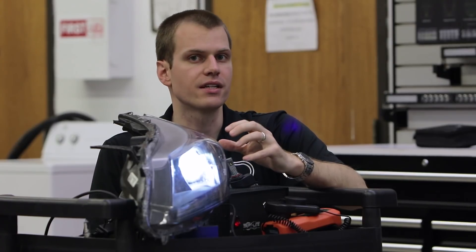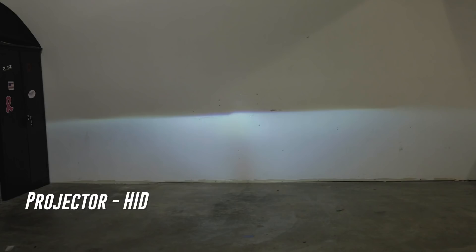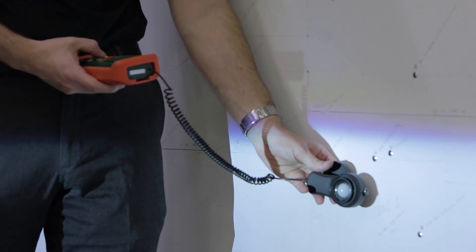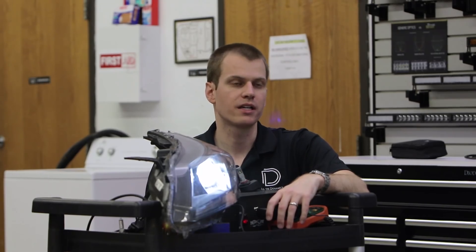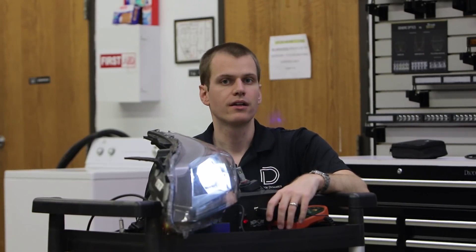So the next thing we have to look at is how intense the whole pattern is. With an HID installed you can see a really nice pattern as we get up to full brightness, and we have 800 lux total — so 10 to 15 percent brighter than that original halogen bulb. We maintain the whole pattern pretty nicely with this setup.